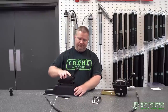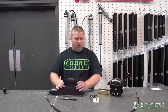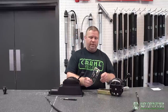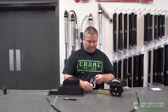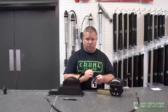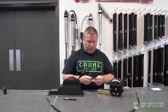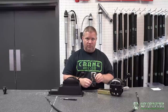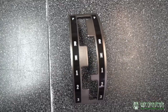Gate plates are pretty straightforward and simple — they're eighth-inch steel, CAD plated, and heat treated. To modify them is even easier. A lot of guys like a shifter that goes straight forwards and backwards with no stops or gates. You can trim them, and if you mess it up they're only sixteen dollars, so it's pretty easy to replace.